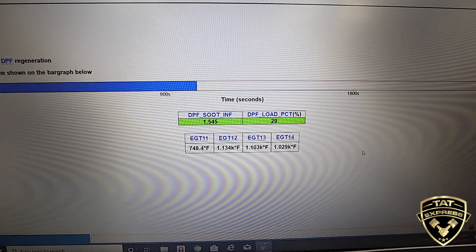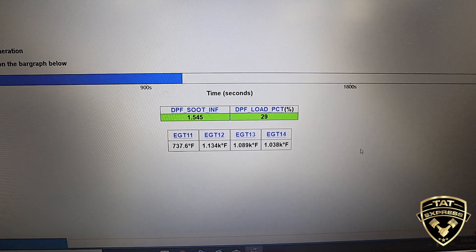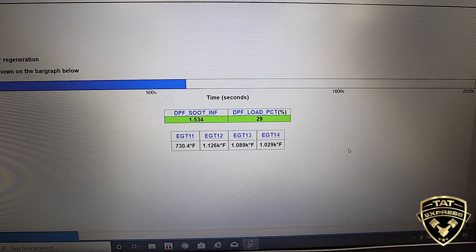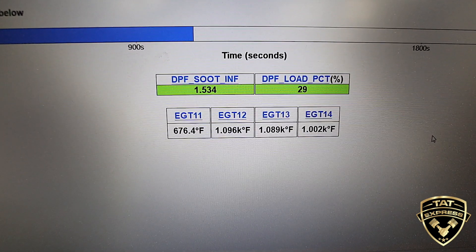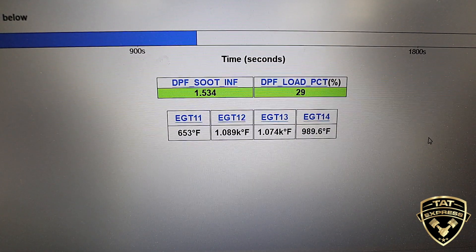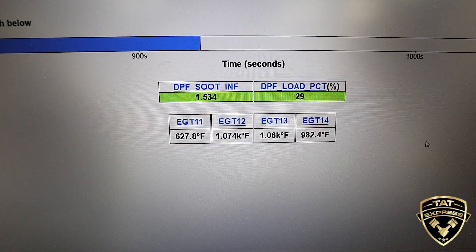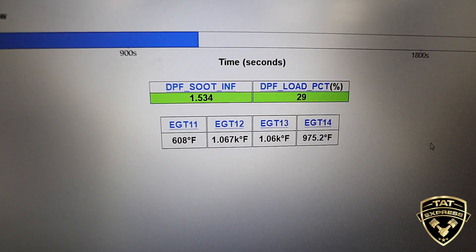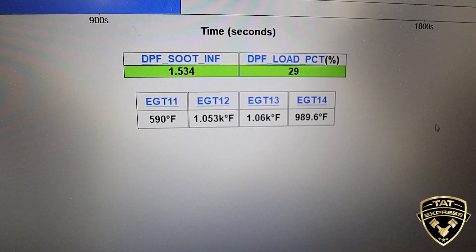Okay, so the high RPM has stopped. Temperatures are still there, and there we go at low idle. So basically what a parked regen is going to do, as I mentioned, is raise your temperature on your filters so that you can break away this soot. Now since this regen didn't fully complete — what happened is since the filter is not over 50% loaded as I showed you in the earlier clip — the computer is just reading that this filter does not need to be cleaned. So this is why it actually ended before the 40 minutes. But we're making sure that you're hitting your temperatures and the soot levels are within specs. So for us, this system is good to go.